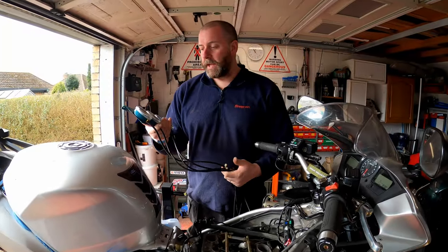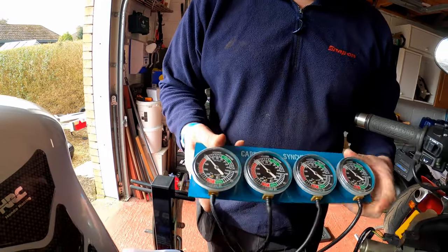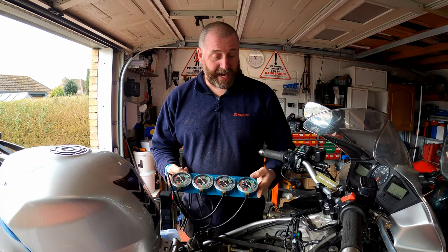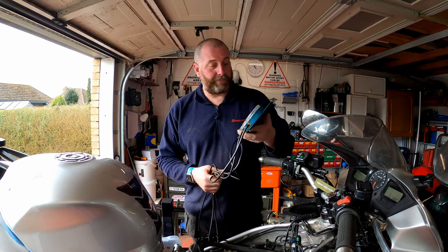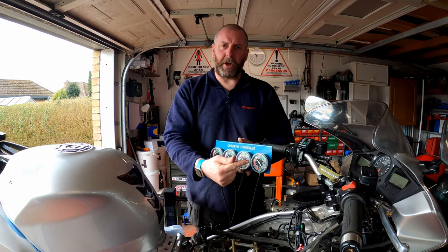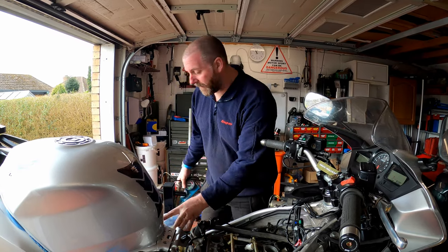What I've got here is an old-school analogue carb synchronizer. You can use this to synchronize the starter valves on the VFR and it's a cheap, highly effective device. The only problem is the needles can be a bit jumpy and being analogue the accuracy isn't absolutely perfect. However, I've used this countless times and it does do the job, especially at the price point. You can also get a mercury type — basically long tubes with mercury levels that go up and down, working exactly the same way.